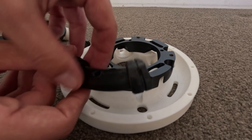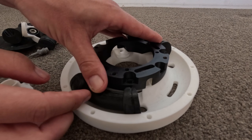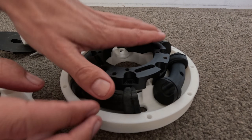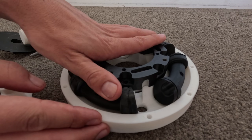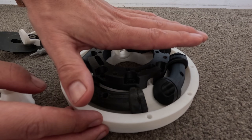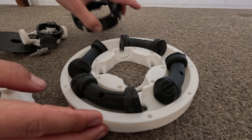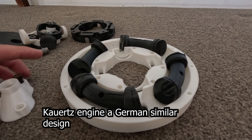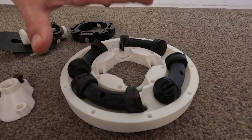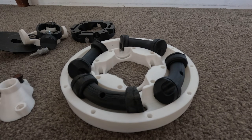On that MYT engine, the pistons are basically connected to this ring — these pistons are stationary, attached to this ring — and these pistons are connected to the other, so they always stay with each other. But the problem is you've got three surfaces to seal, and these seals have to handle the whole power of the engine. I was talking to a guy in the comments who had actually worked on the motor, and he said that the only seal was tolerance — they just had a super tight tolerance between the plates. That's why it would only run for a short time before the heat would get too much, it would distort, jam up and rub.